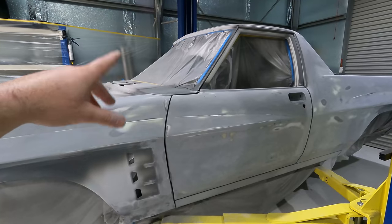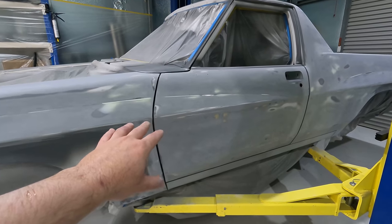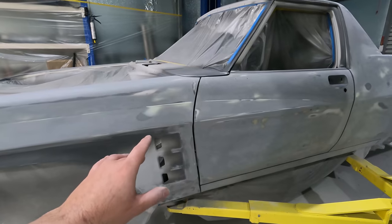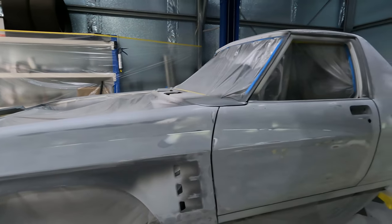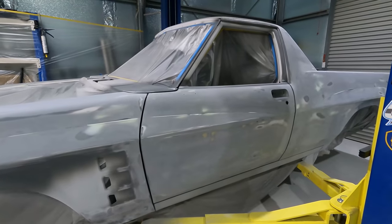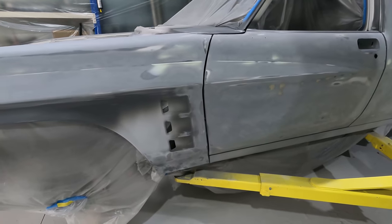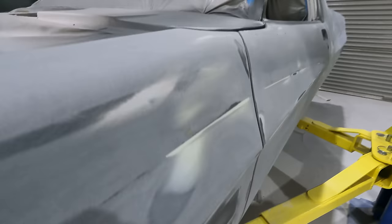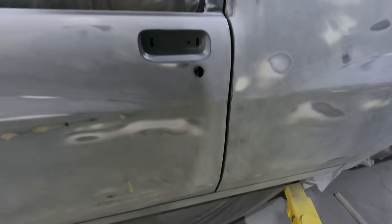The tape line I'm going to leave for now - I'm going to do the other side, get it to exactly this stage, and then I'm going to sand that line out that I've put in here. I just don't want to do it yet until I get the other side done because I want to make them match. So the plan is do the other side, then blend that line in on the rear quarter, door, and guard. Once that's done I'm going to take the guard and the front nose cone off, I'm going to paint them off the ute - maybe the door as well. That's why I haven't done anything with down here. I want to try and blend the guard with the door the best I can - I've done a pretty good job, it's near bang on, maybe half a mil out.